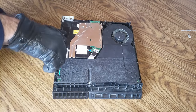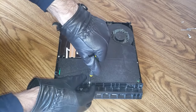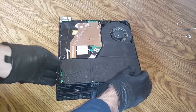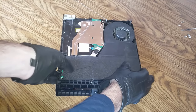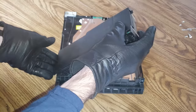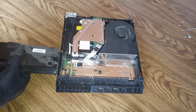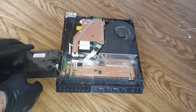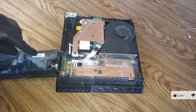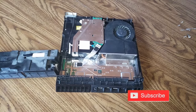Now we will have to remove 3 T9 screws — one on the back left, the front middle, and the back right. Now it's time to remove the power supply unit. This can be a little bit tricky and may take a little bit of effort. Be aware that there is a connection cable that you can damage. I kind of wiggled with my left hand and then lifted up on my right hand and it popped up. I'm going to fold it over and set it on the table — notice there is still a cable connected. If you want you can go ahead and disconnect the power supply unit, however it's not needed. The power supply unit is pretty dirty.